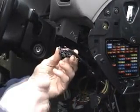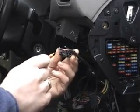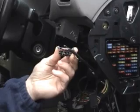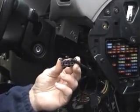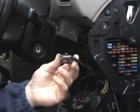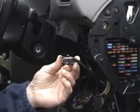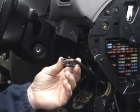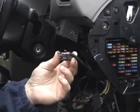The next pins to test are pins 4 and 5, our 2 earth lines. So for that we need to switch our meter to resistance. We also need to disconnect the vehicle battery, as you can't do any resistance checks on a live circuit. The voltage the meter uses to carry out the resistance test will actually damage any control unit circuitry.